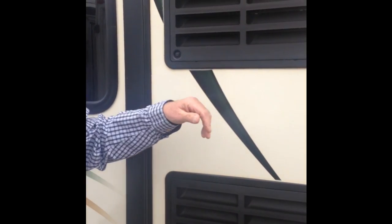This vent is the top of the refrigerator vent — it keeps air circulating through the back of the refrigerator. Most trailers have it on top with a cap. On our older '87 trailer, when the refrigerator was acting up on a trip out to Colorado, Wyoming, and Utah, we actually installed a small air conditioner on the roof for the cat and put small computer fans in the vent to help air circulate. Computer fans are 12 volts and you've got 12 volts anyway, so we just hooked them into the system. Unless you're camping in extremely hot weather, you really don't need to worry about that.